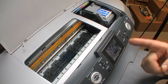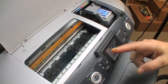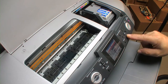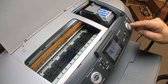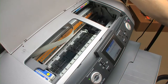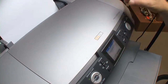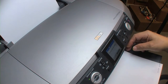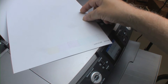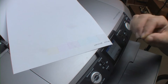I did the cleaning cycle, then turned it off and let it rest, because when I turned it on initially this morning I still had a bad nozzle check. So let's cross our fingers and see if this did the trick. There's a paper feeding — and oh, glory hallelujah, we have what appears to be a perfect nozzle check! Awesome.